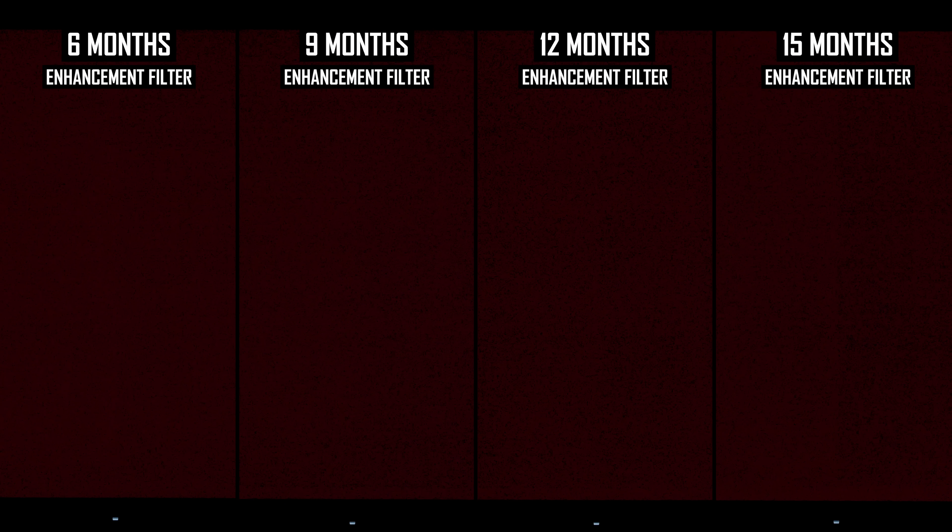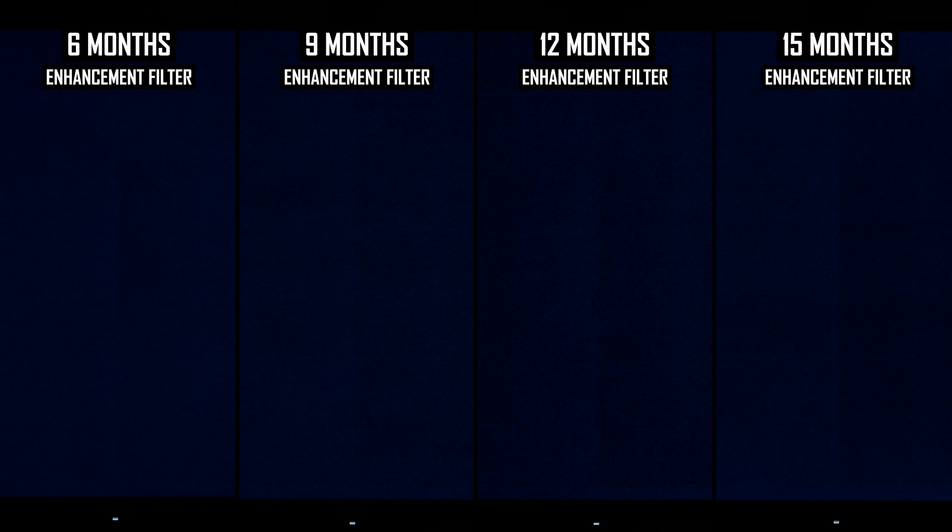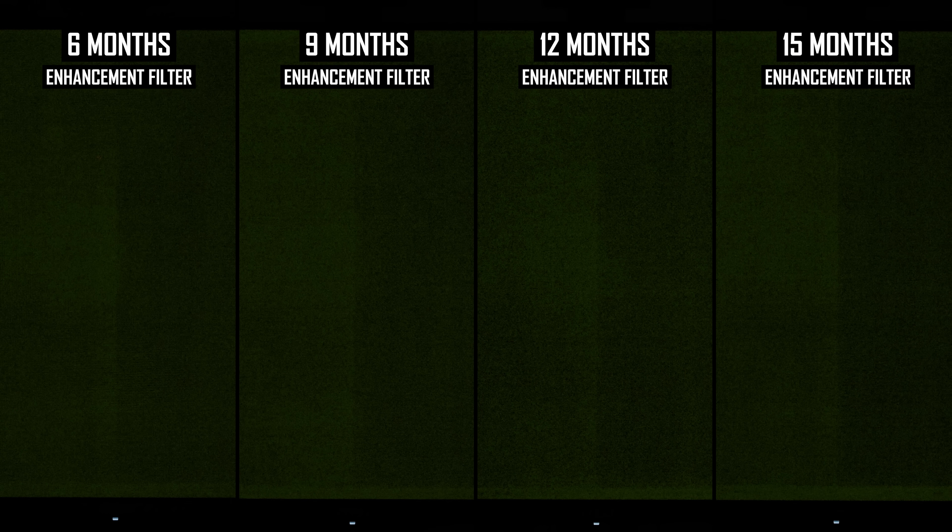We can also use colour examples to explore how individual subpixels are degrading. The red subpixel has degraded the least, though at the 15-month mark there are some very faint signs of vertical line and taskbar artefacts. The blue subpixel is the second most affected with more obvious burn-in going back to the 6-month mark; it seems to be degrading slowly with only small changes at each 3-month interval. The green subpixel is clearly the worst of the three, showing all three artefacts in the most obvious way and appearing to degrade the fastest, particularly in left-right uniformity.